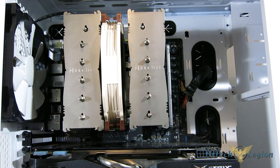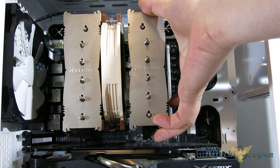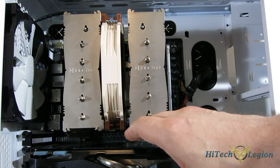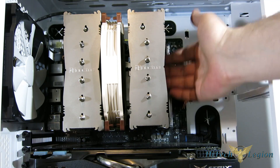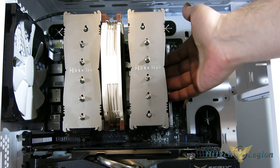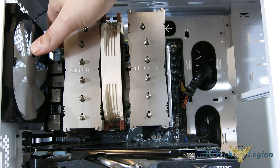Once it's installed, the offset of the D15S is very noticeable, especially if you've used an NH-D15 before — you'd definitely notice it right off the bat. It's much higher from the GPU, clearly clears the first PCI Express slot, and up front without the fan you've got that 65mm of clearance for RAM in front, as well as in the rear if you're using an X99 board.